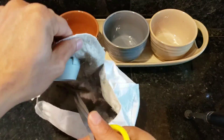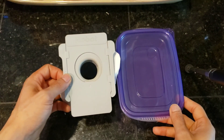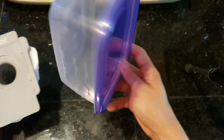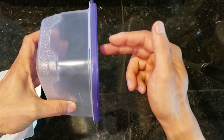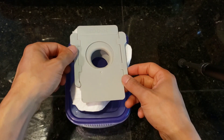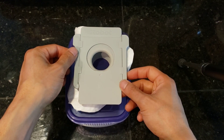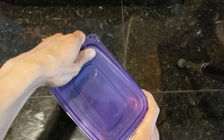First thing you want to do is remove the plastic part. I just kind of cut around the bag, and I'm going to keep that plastic housing. Next, find a suitable Tupperware — you want one that's about the same size as the bag because it will fit nicely in the self-emptying bin, and try to put the hole where the plastic part is going up towards the top.